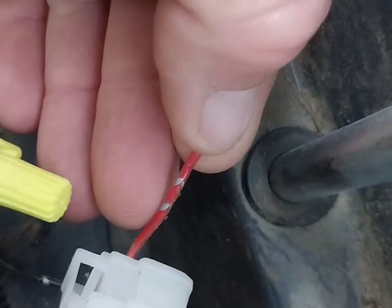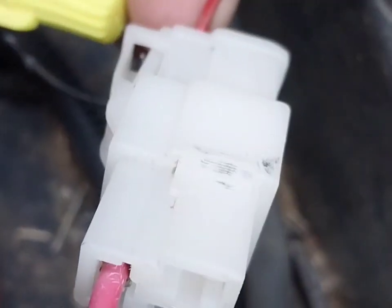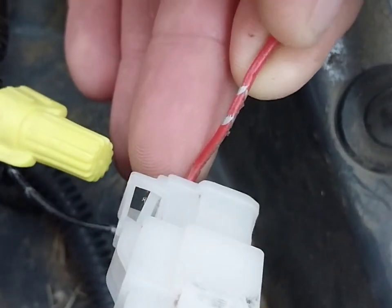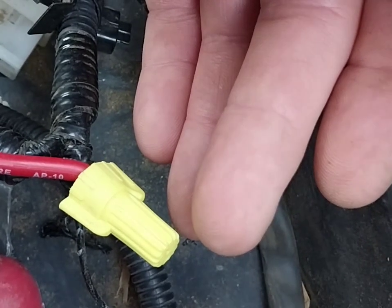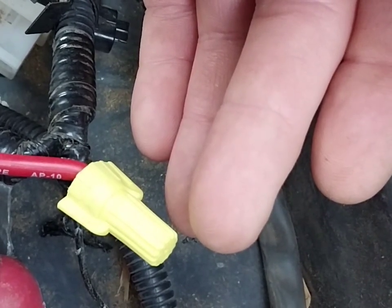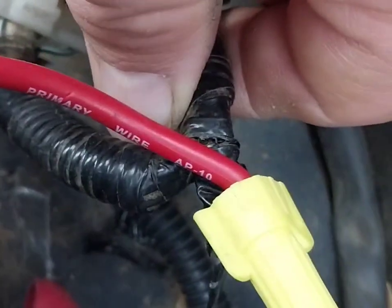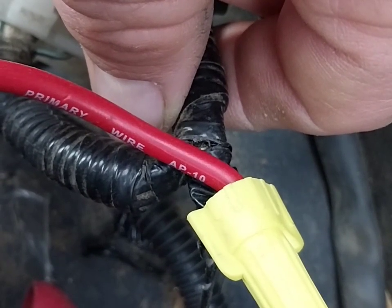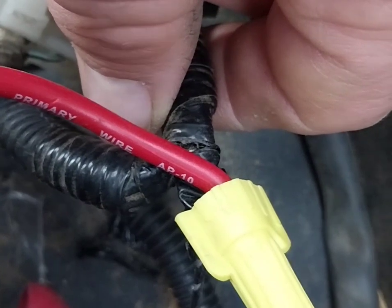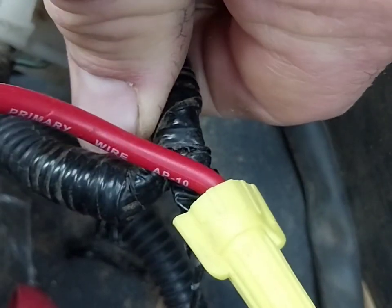I'm back. I was getting power here at this plug, but for some reason after the plug, somewhere under the seat, I was losing my power. It went straight to the compressor — as far as I could tell the only break was the ground at the micro switch at the up-and-down switch. So I ran a new power wire straight from the plug into the compressor. I haven't added the fuse yet — I'm going to put an inline 10-amp fuse here.